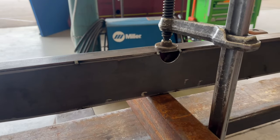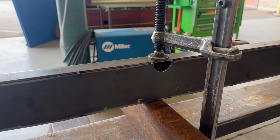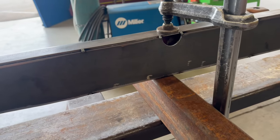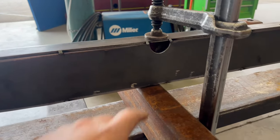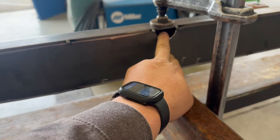A lot of guys talk about welding a nut or something for the body mounts, but I don't want to do that — dealing with stripped nuts that won't break loose. I know there's a bunch of different options, I just don't want to go that route. So I figured my cleanest option was a little pocket big enough to fit an end wrench into.